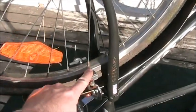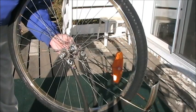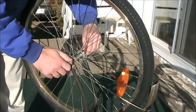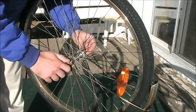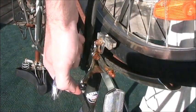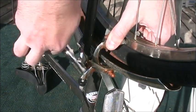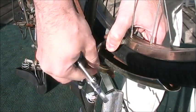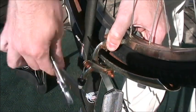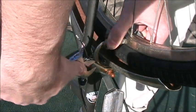Removing the front tire is a three-step process. You need to release the brake — that will give you clearance, open it up, and allow you to move the tire. And you have to undo each bolt on each side. Set it up flat and level in the wheel opening, then tighten them down. Now that we have the wheel on and relatively centered, make sure your adjuster here is midway so you have adjustment either tight or loose. You want to clamp your brakes down — you might need a pair of pliers to pull on this. It's very nice and tight. Then tighten it down with a wrench. There should be enough play in the braking system that when you let go, it backs off enough that it won't be riding against the wheel. If not, use your adjuster and back it off some.